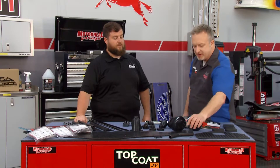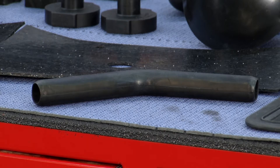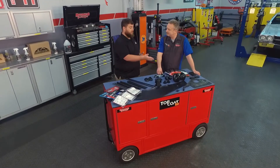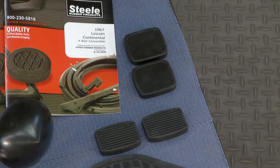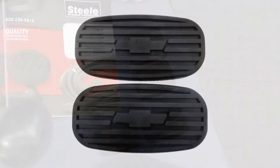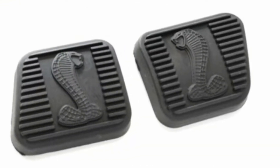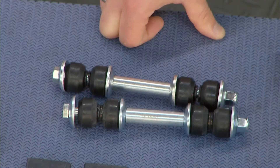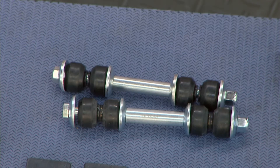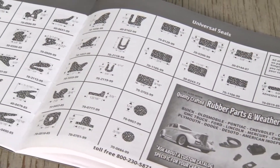Speaking of small pieces you might miss — what do we have right here? That's like a drain for a cowl. A lot of times those are really gone when you're working on an old car, and you'll get water in places you don't want it. We have pedal pads — slip-on types. What about Cadillacs or certain brands that have their name stamped on the pedal? We do have several licensed pieces for Cadillacs, La Salles, Chevys, Cobras that have that iconic emblem on the pedal. We also do revulcanizing services where we take an original pedal, remove all the rubber, and put new rubber on. We do motor mounts, stabilizer linkages, custom windshield gaskets for chop tops. There's a lot of things we do that people don't know about, and we have the resources in our catalogs.